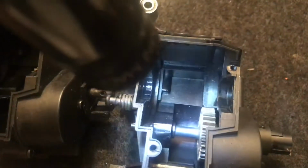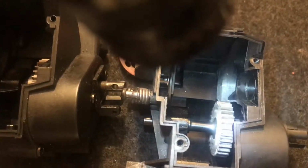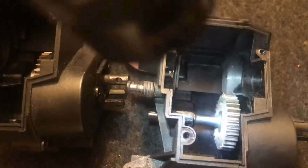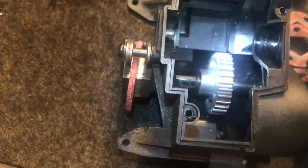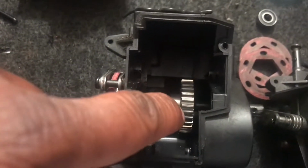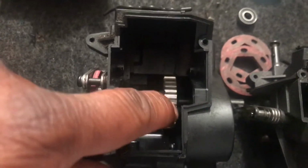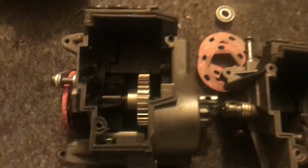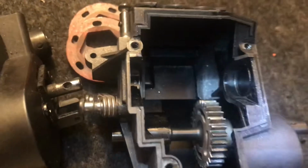Basically, what happened is the shaft is flipped around. This allows you to clear the other two gears from this gear, engaging the other big gear there. So you want to flip the shaft. Again, it's the same gear, but you just flip the shaft and have the gear moving to the right to clear the other gears and not riding on the other mesh. So that's very, very important. Also, you do not modify this. You just flip the shaft around, as you see here as an example.